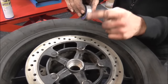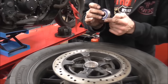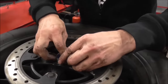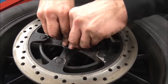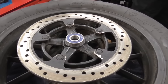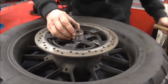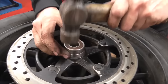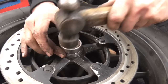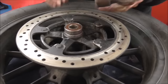A little smear of grease around the outside - that just eases it into position. If you go to your dealer to have this done, they should be rightfully charging you a couple of hours. It is a couple of hours of work - you take your time, you do a nice job. It doesn't want to go in any further at first, so clean up the old bearing and we're going to use that again as a drift. Just pop that on top and just drift it in by going around, working in triangles, getting it all the way in without distorting it.